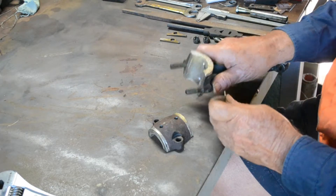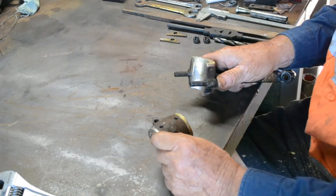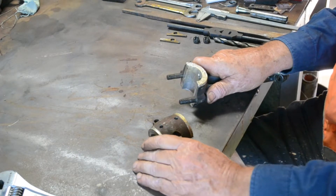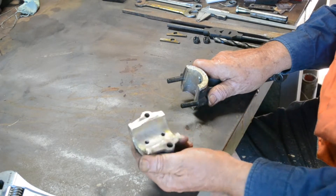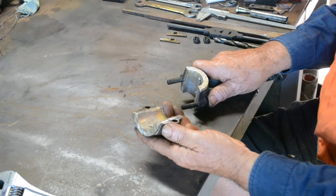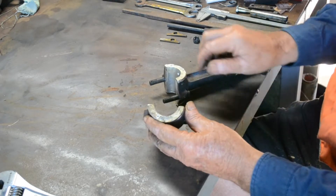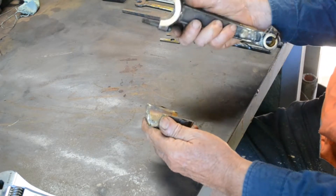You can keep adjusting these bearings with these shims until you've worn the crankshaft out and it requires regrinding, and then of course you need to white metal them again. But that's probably after about 500,000 miles. You've got plenty of metal there to adjust them up. That's one reason I like to use this method of doing white metal bearings. Sometimes they machine them now to take shells — it's very difficult to get the end clearance using shells, and once they're worn out you've got to buy another set. Whereas with this way, you can just keep on adjusting them.